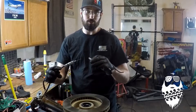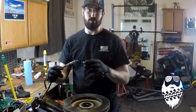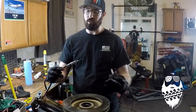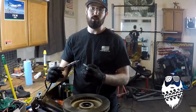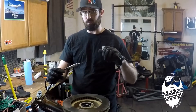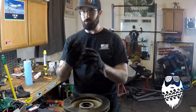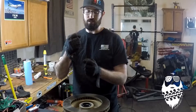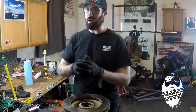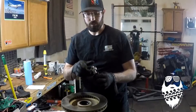You can also poke a hole in your boot to get a little grease into your tie rods or ball joints, but I wouldn't really recommend that — you're creating a problem in the future because now that boot has a hole in it, which could lead to premature failure. Those grease fittings are actually on the bottom of the joint, so the grease is supposed to come up from inside the boot anyway, so I'm not sure how much good it actually does.